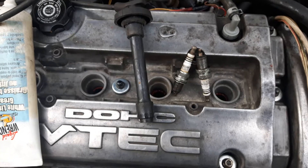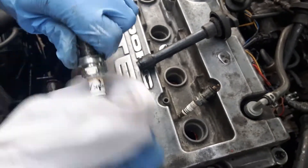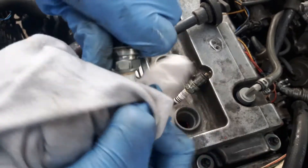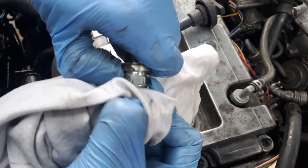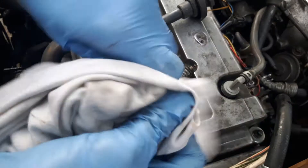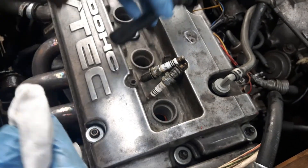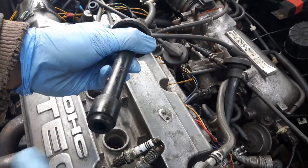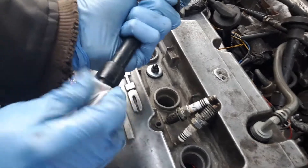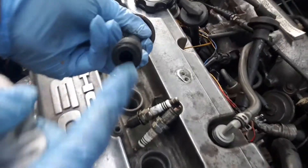I'll quickly try to show. Put some lithium grease on a piece of cloth and rub it inside the wire. Sometimes it's not that easy to bring the carbon out. So this is mostly cleaned, but this line has to be fully cleaned — I'll scrape it off. Do the same thing on the other end and on all of the spark plugs. Put some engine oil, send the cloth in, and rub and clean it. Look — there's some carbon there.